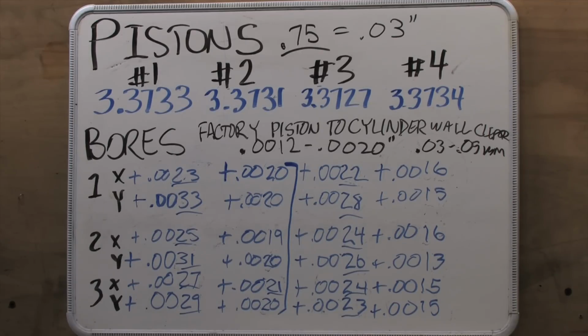Number 4 is at the limit for taper. Anyone with a head on their shoulders would junk this block and start over, or punch a new set of holes and get a new set of pistons to correct this, because at 30 overbore, there's no room for machining to take out the imperfections that this block already has.